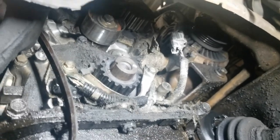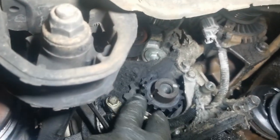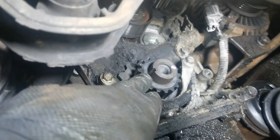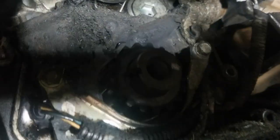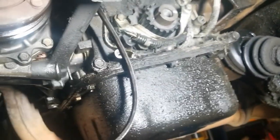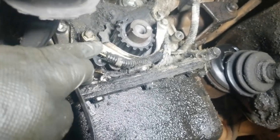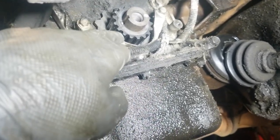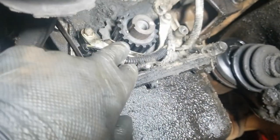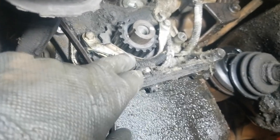Now I just need to pull the rest apart and clean this mess up. The crank seal doesn't look wet around it — it's just filthy. A lot of times when a belt breaks it can also damage the crank position sensor, so you may need a new one. You may also need to go to Honda for the new bracket piece held on by two 10 millimeter bolts, because sometimes it breaks.